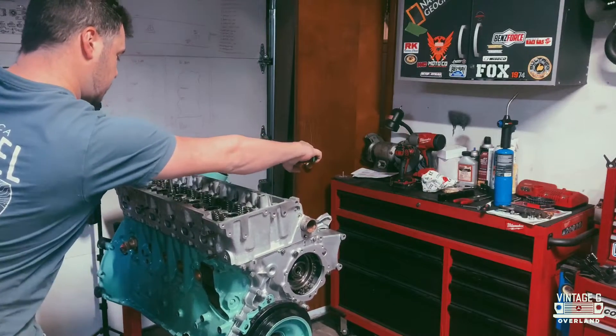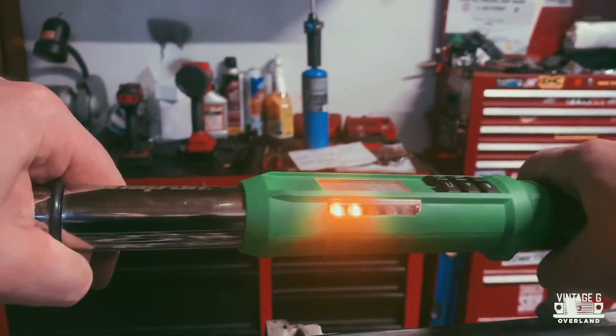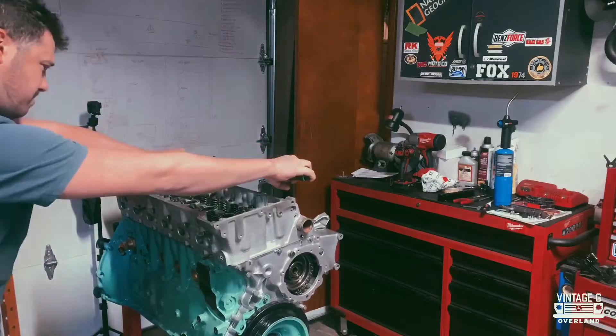On the second pull for 90 degrees I hit about 100 Newton meters. You couldn't imagine how hard it is to do this on an engine stand that rolls, and if you aren't that strong, call some help over and work together.